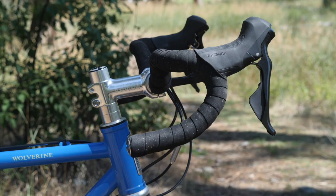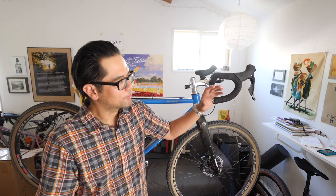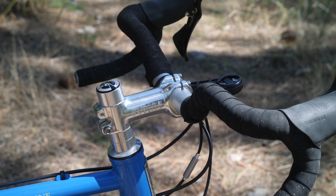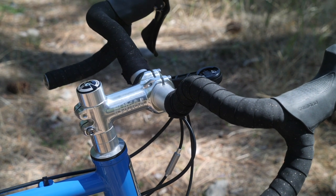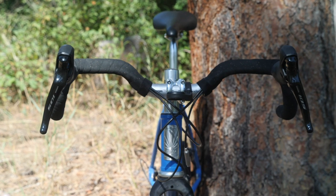What are the things I don't like? The first potential dislike for some are the handlebars — it's kind of hard to miss. Aside from the awkward shape, I did like the shallow drop and the slight flare; if you can get past this middle hump, it's actually a pretty good handling bar. On this particular build it didn't quite make sense to me because the main function of the hump is to raise the riding position, but there was plenty of room to do that with spacers. That said, if you bought a used bike where the previous owner cut down the steerer tube aggressively and you can't get the bars high enough, this is a good option without resorting to a steep-angle stem. Another issue with these bars is the narrow space at the clamp area, which could be problematic for mounting bags.